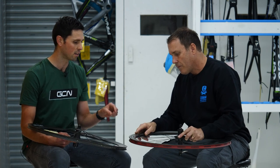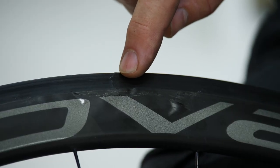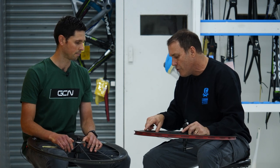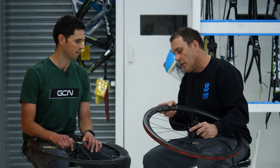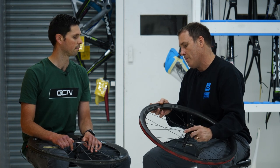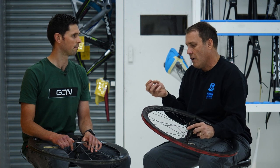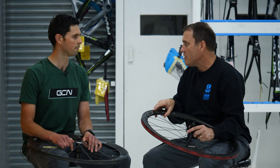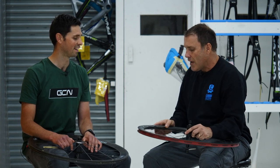What about the damage on that wheel — going across the main section, into the brake track and into the clincher bed? This one's brake track is fairly evenly shiny, so no problem there. But the rider has hit a pothole or similar, causing a fracture through and across the brake track, and the crack has gone through the wall of the clincher. Because of the way clinchers are made, it's not wise to repair a beading edge profile — the whole principle is to stay embedded behind the bead and not pop off. So that's a no. A spoke pull-through causing the wheel to run out of true is also a no-no for the same reason — we can't test to destruction.